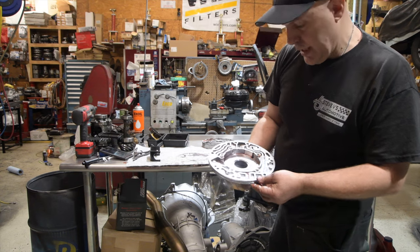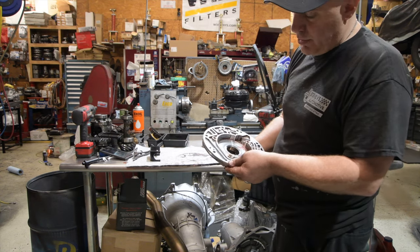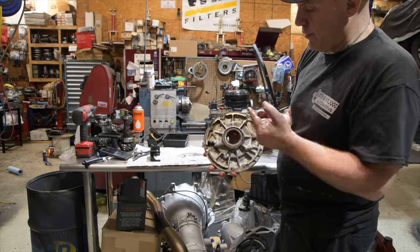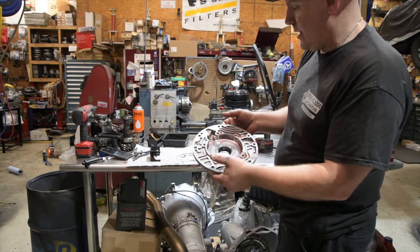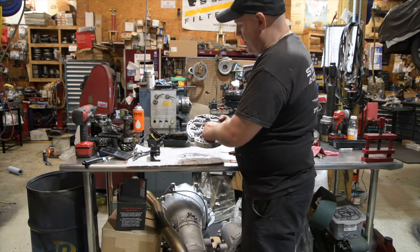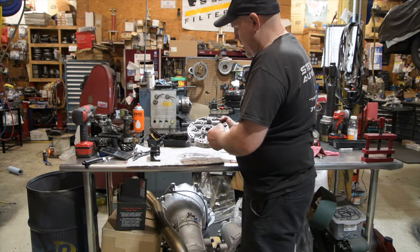We'll replace the bushing. It's a 690 pump, which was the last design pump. So this pump actually has a step in here that keeps the bushing from walking out. So this one doesn't need to be staked. It's actually saved me from having to knock these bolts out, take the stator support out.